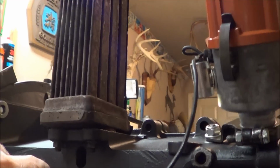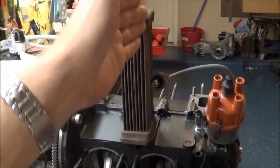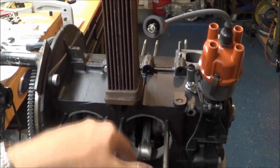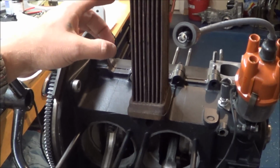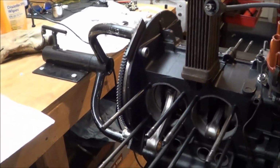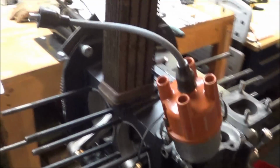So it's $100 and something for a brand new one of these, and everyone had suggested to go with the older style where you've got the fan shroud that goes across here, and your new oil cooler goes on the back of it, so it's outside and you get more airflow down in here to 3 and 4. So that's a lot of what's in the box over there: a new doghouse fan shroud, and the oil cooler on the back side. Since I've already bought the 8-pass external oil cooler, I'm going to hook it up as well. So it's paid for, may as well.